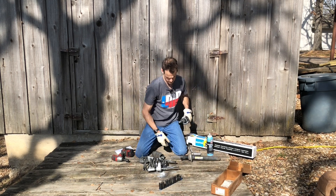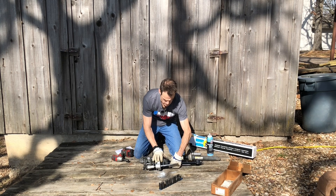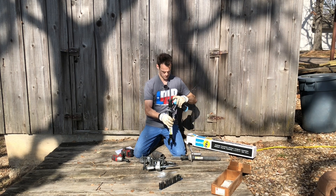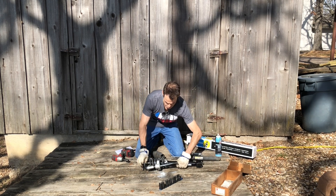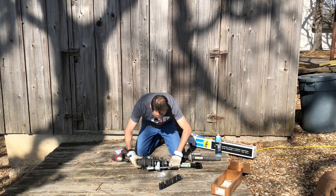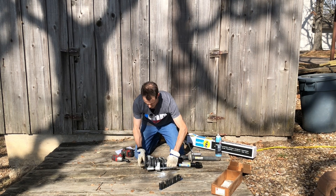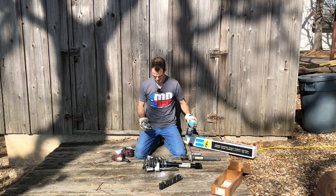So our old part right here, here's our new part. Just stick this little doodad right in here, line up the bottom of the mount — I might even grease this up a little bit just because I like grease and I already have some out here. A little added cushion to collect dirt throughout the years. Get that all probed up in there, get my dust boot pressed on all the way. Inspect my mount, which still looks excellent — put a little grease on there.